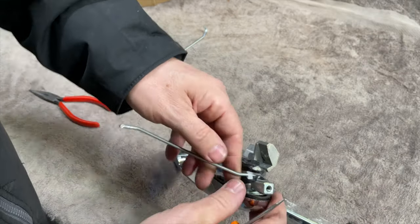Let's get the door panel back on. Starting with the switch. The little switch, we'll just pop that back into place. Back it up through the thing, clip it in. That's that in. We'll get the door handle reconnected. So we're going to clip that back in first, pop the wire in, swing that around and clip that in. Oops. Then we'll reconnect, pull that down, slide that into its little holder, and press it in, and it clips into place.